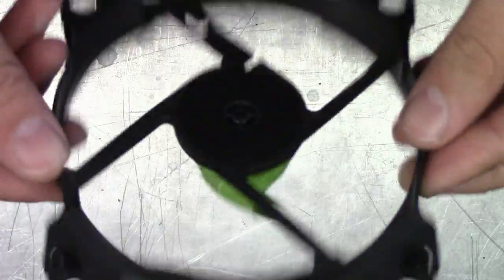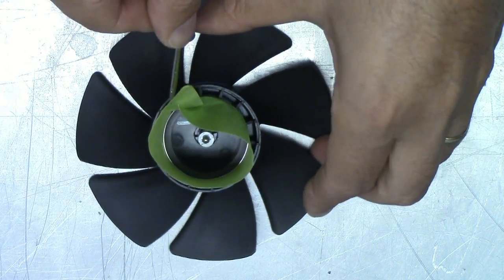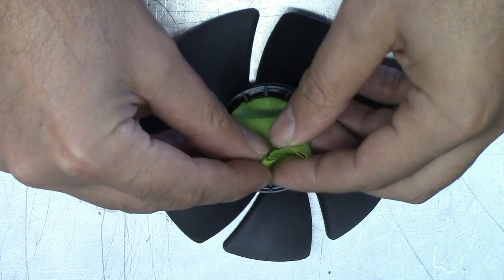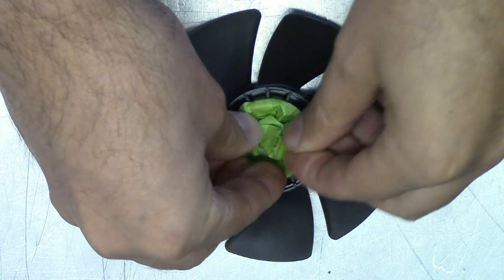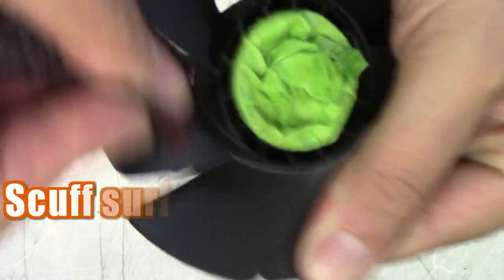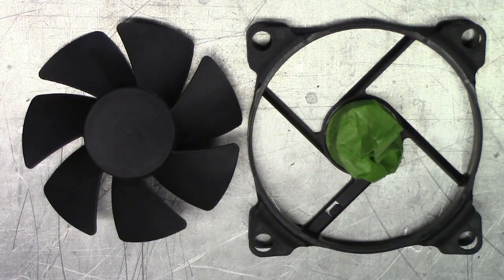A warning: if you try using the blue painter's tape from a hardware or home improvement store, that tape has a very low adhesion level and it's probably going to peel off and cause frustration. If you can find this 233 Plus tape at an auto body specialty store, it's much better because it has stronger adhesion. Next, I'm using Scotch-Brite pads to scuff the surface — this gives adhesion for the first coat of primer on all the plastic parts, including one of the trim rings I'm going to paint as well. Now everything is prepped and ready for paint.